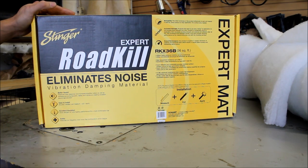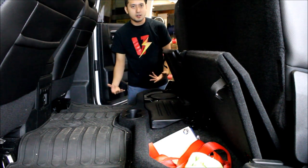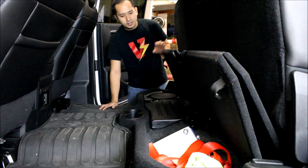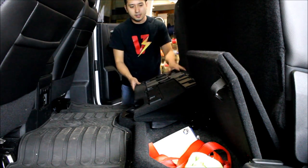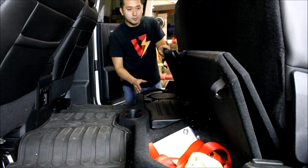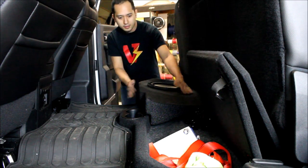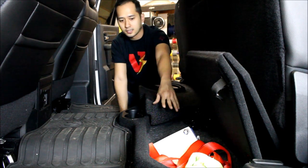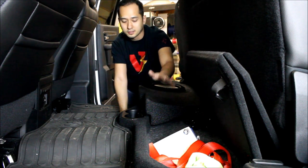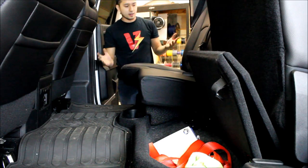Also when doing any kind of build, this is the foundation of your sound system — put sound deadening wherever you can. In our 2015 RAM you can see the factory subwoofer solution from Alpine. It's okay, but our customer is looking for better sound quality and more output, so we're going aftermarket. The factory piece is the most practical because you can maintain the cargo trays. However, because we're doing a prefab upgrade, we're going to have to lose those. We've got the Phantom Fit in now — we have to remove the trays because the enclosure comes back under there, but it only takes up the 70/30 split so we can maintain the cargo tray on the other side. We got way better sound quality than the factory and maintained most of our practicality.